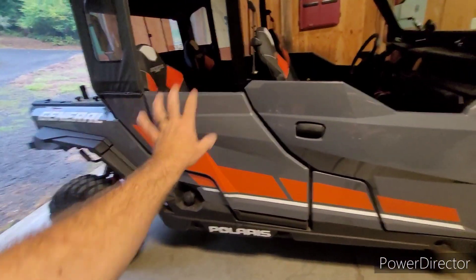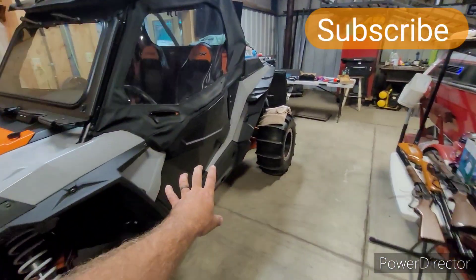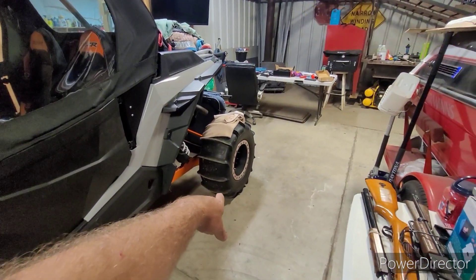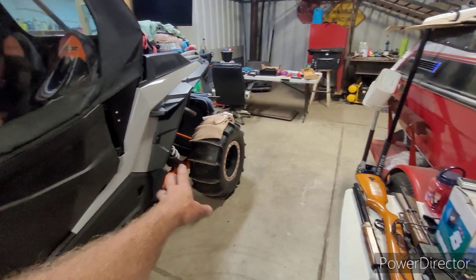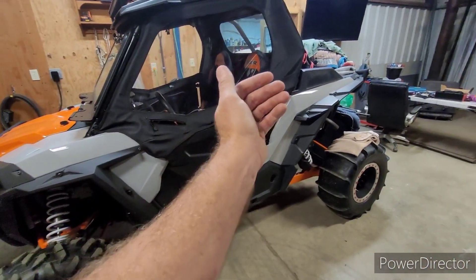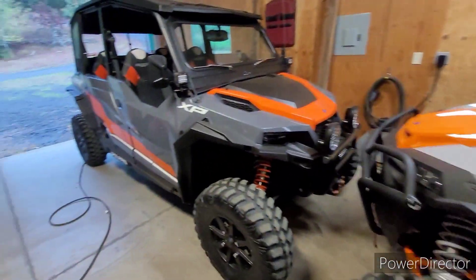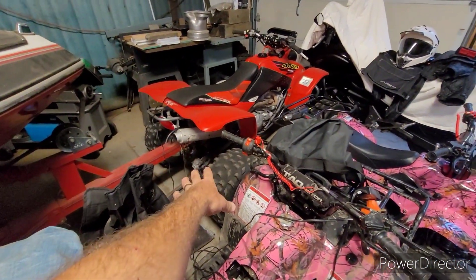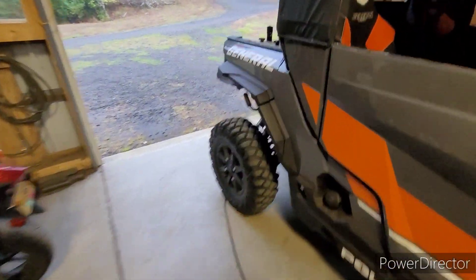That's mainly a situation I have that I'm still working on. This other machine here is something like 160 horsepower. I could air those tires down so they only have four or five pounds in them and it'll do fine — it's a lighter vehicle, it has more power, the turbos have a bigger clutch. So there are lots of reasons that would work fine and give you more acceleration. The paddles I run on that have hardly any tire pressure in them, and on my recons they also have very low tire pressure.